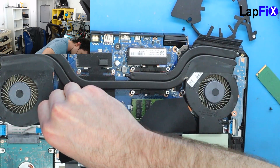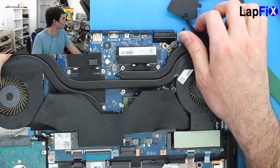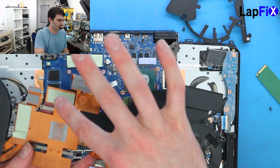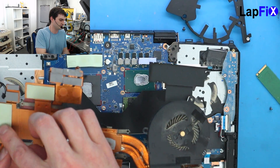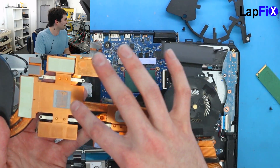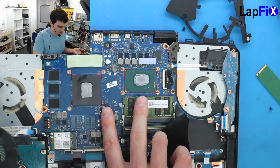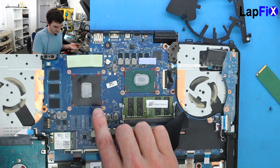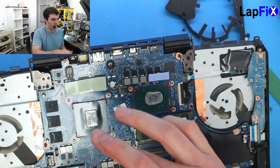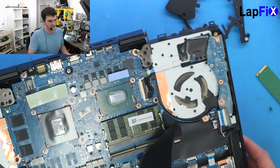Once you get all the connections up, it should be good. Just lift up and be very careful because there will always be more connections. You can see these are thermal pads that go around there — you can usually leave them alone. You really just want to focus on the thermal paste here, which is the CPU and GPU right here. So we want to clean that off. This one doesn't look too bad, but this one looks like it really needs it more. You can kind of see the little holes in between there — you want the thermal compound to be covered. You don't want any holes because the metal is going to be touching the chip, and we don't want that.